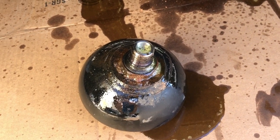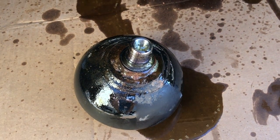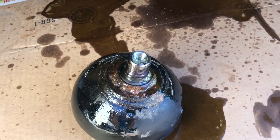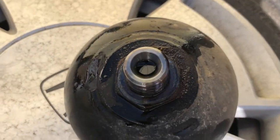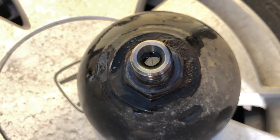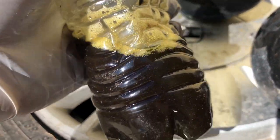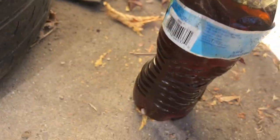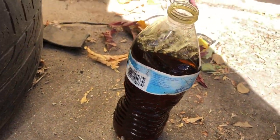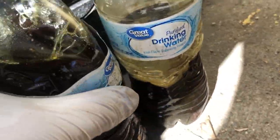The foaming tells me the membrane inside is probably broken. If you did a pencil test on this it would fail. A lot of fluid came out of it. The other one is right here and the fluid is just sitting in there normally. Also look at the color difference — this one is very black, that one is not as black. You can actually kind of see through the good one; the bad one you can't.